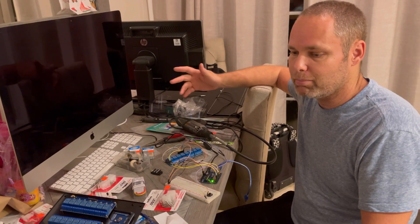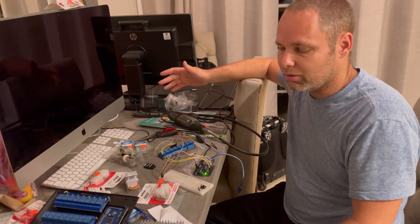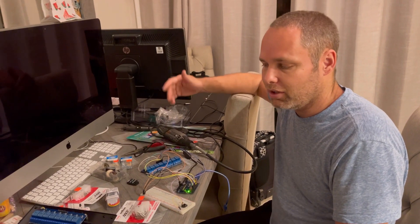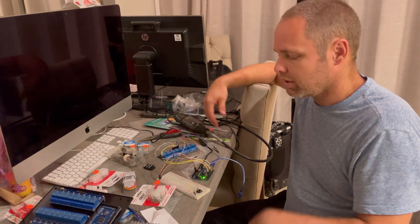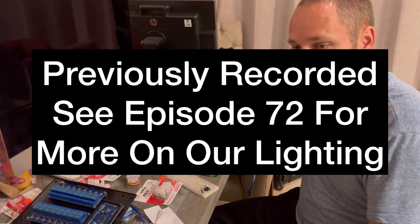We can always fail over to the bus batteries that normally start the engine. You don't want to hook to those all the time, because if somebody leaves a light on and you kill your bus batteries, then you can't start your bus and that sucks. So that's what we're kind of doing tonight, and hopefully we'll be throwing it in this weekend.